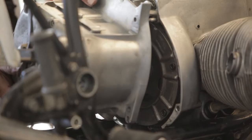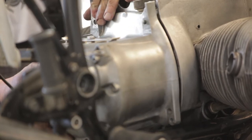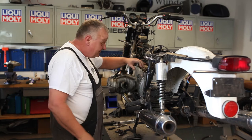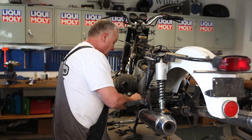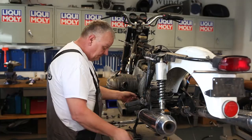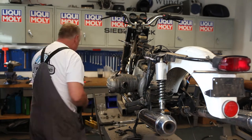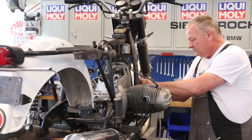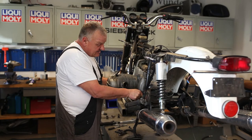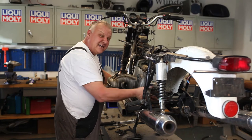I'm going to reinstall this gearbox. There we go — it all lines up, thanks to the centering tool. I've got all the bolts started in the gearbox-to-engine interface. Before I tighten the bolts up, I'm rotating the engine at the front of the crankshaft a couple of times just to get the clutch perfectly centered. Now we're ready to tighten.